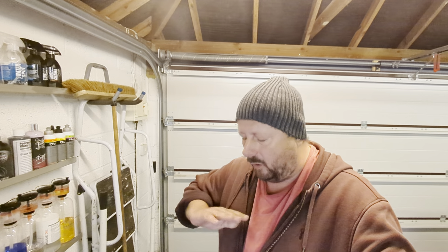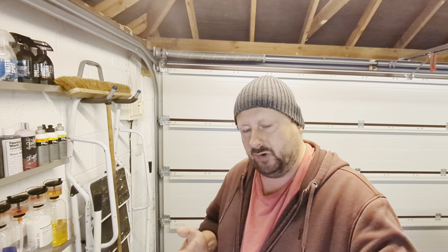Then the section where I've washed it with water and dish soap, wetted that out and wiped it — so there shouldn't really be any surfactant there — and then panel wiped it afterwards. That is the next worst. Then after that, the one where I've gone straight on, coated straight on top of a polish without panel wiping, just buffing the polish off — seems to be doing really well. But the best one by a long way seems to be the primer. So that's after one week of coating. Really interesting.